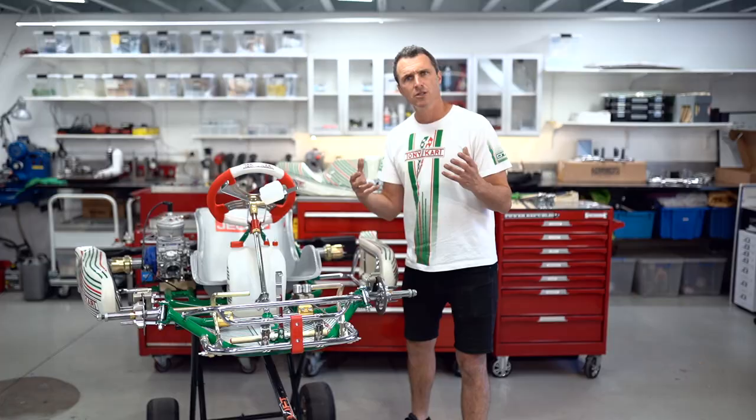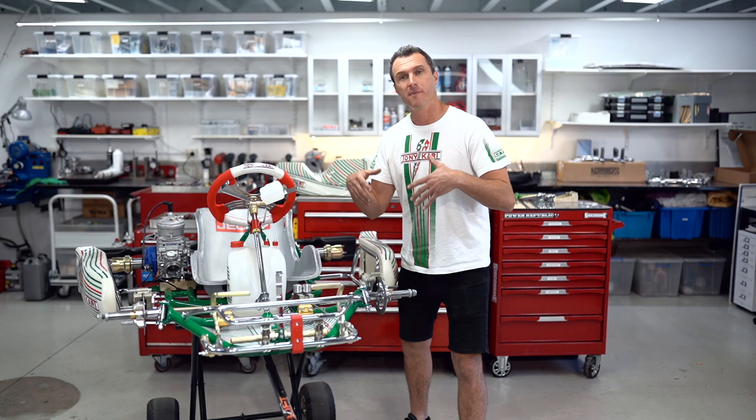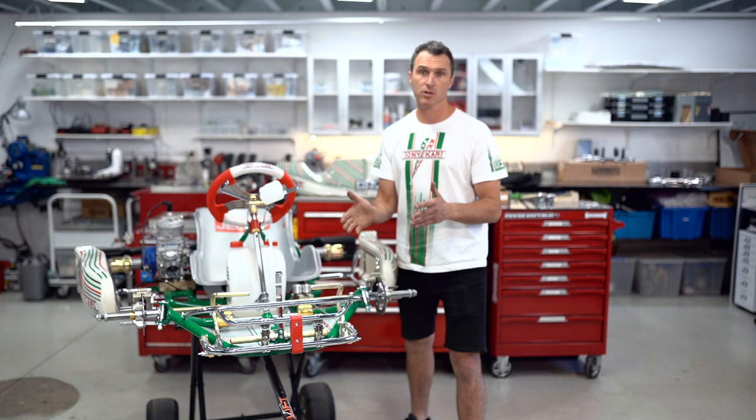So I know what you're thinking, what the heck, Des, how is that supposed to help me? Well, basically, if you want the maximum steering effect, maximum jacking, we're going to put the tie rods into the bottom position on your steering column. And then if you want a lighter steering feel, we're going to move it into the top position. And that's going to give us the least effect of the Ackermann on the go-kart when we're driving.